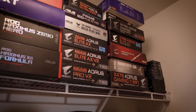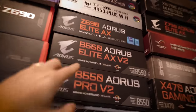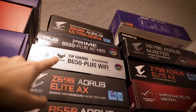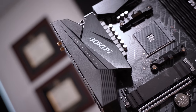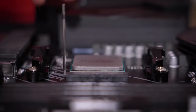Now it's time to throw everything we just cleaned back together. We'll assemble the platform first and throw it into a new case. Before we get ahead of ourselves, we need to choose a new motherboard — the last thing we want is another ITX board in an ATX case. So something like this B550 Aorus Elite, or maybe a B550 Prime, which is a bit cheaper. I think I'll go that route — it should have the features he's expecting. We'll gently drop the CPU into the socket and give him a fresh BIOS update, assuming it doesn't drop support for Zen 1.